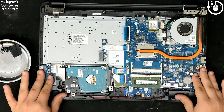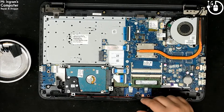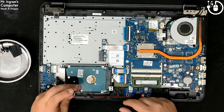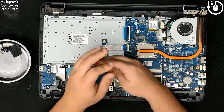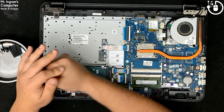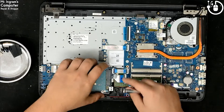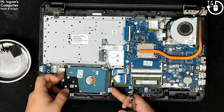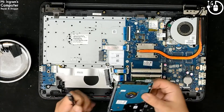Perfect, and we're on the inside of the laptop. First thing we're going to do is find the hard drive — there it is, perfect. Just unscrew it; it looks like it's holding by three screws: one, two, three. I'm gonna go ahead and pop off this cable so we don't have to worry about it. Now I want to take off these side pins.